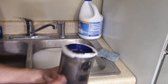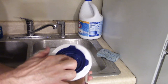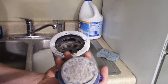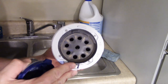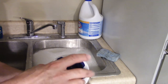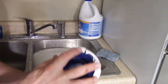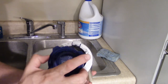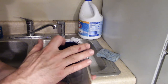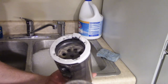Here's our Samsung container. Here's our hyperfilter — there's a little thing right here that says pull, and you can just press it straight up and pull. You can probably see it's pretty dusty looking and pretty dusty in there. Now everything lines right back up when you go to put it back in. Using the push button as a reference, we have a little notch right up here and it all fits right back in place — these four notches and then that notch where the push button goes.